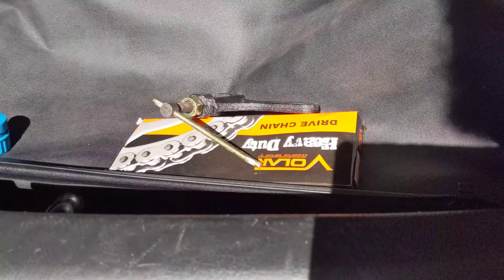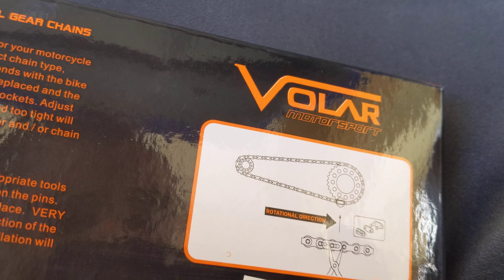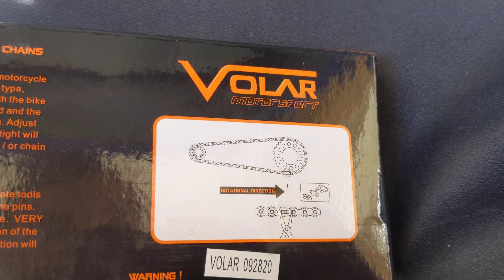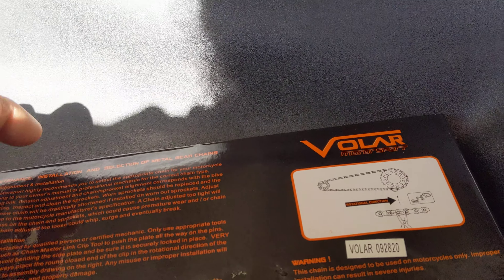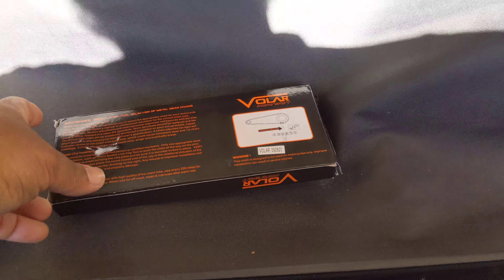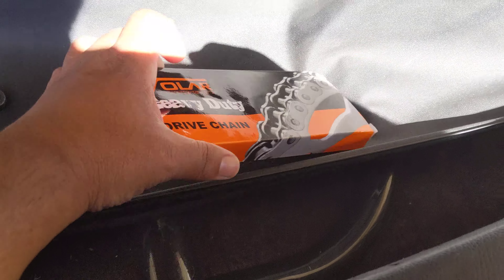I got a chain breaker because I ordered this one from Amazon for $15. I love the Grom — good old cheap stuff. I saw good reviews on it. So rotational direction — it's funny because this direction I believe is the opposite of what's on there now, but it may actually be the right way. Clip facing down — yeah, it's the right way. But this is a non-O-ring chain, just a replacement chain which I'll probably need to adjust a lot more. It was $15, I figure why not. This is going to be my first time replacing a chain on a bike, so if it's only $15 and I mess it up somehow, it's not a big deal. This is a 106-link chain, just like the stock Grom.